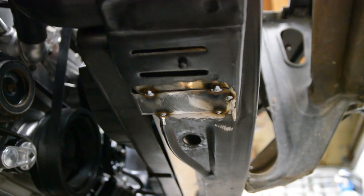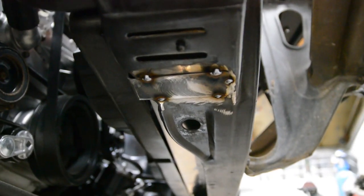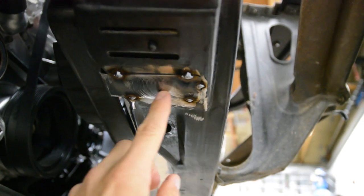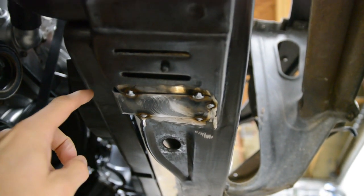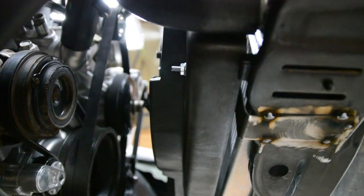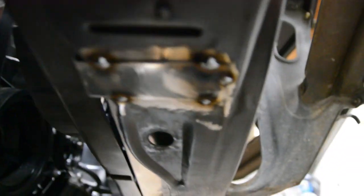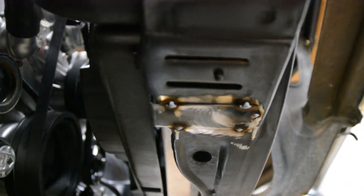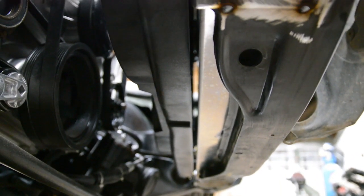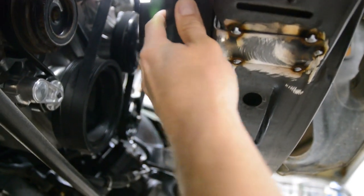Here's how the bottom brackets turned out — I don't have any footage of me making these. Here's the electric fan and the bottom of the core support. The bracket comes like this up, over, and then up again, and then I have a fastener right here. I've got two — one on each side — and they're just tacked up for now. Just need to put a couple stitch welds there, but you can see I have a gap between the fan and the radiator. I don't want any rubbing, but it is solid.